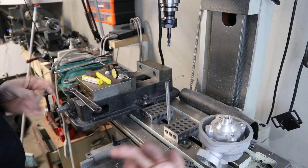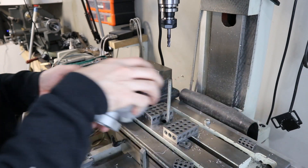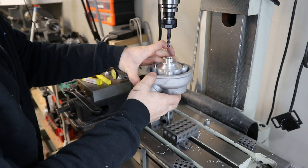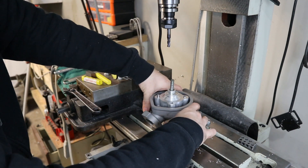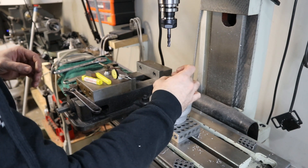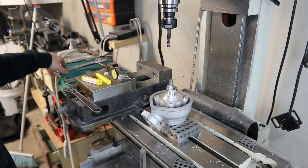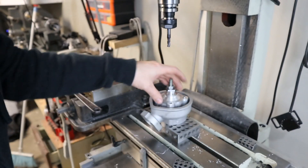This is my pretty rudimentary setup — a T-nut with a long stud through it and a couple of 1-2-3 blocks. Once you have your cylinder in with the inserts and alignment pieces, place it down onto the 1-2-3 blocks. Make sure these are clean — scrape off all the gasket material. Just a little washer to keep from marring the surface, then cinch it down nice and tight.